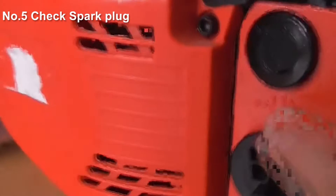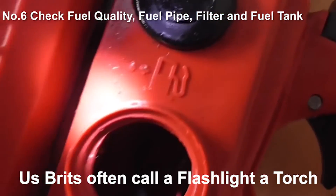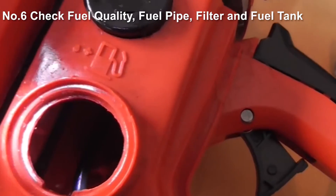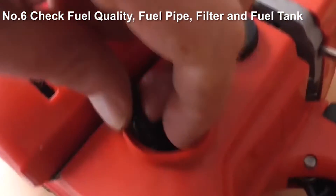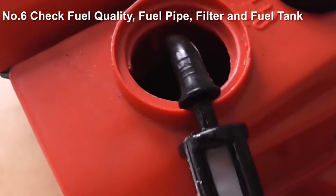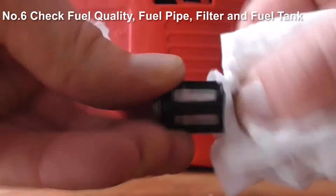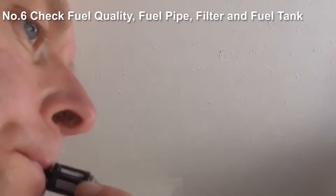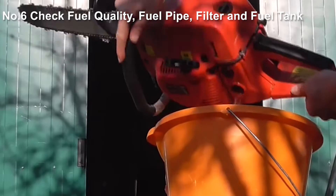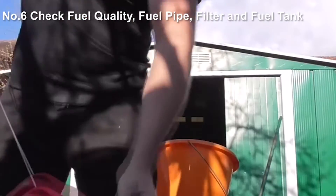The next thing I would do is check the quality of the fuel and take a look inside the fuel tank. The best way to do that is to get a little torch and have a look inside there, making sure that the fuel pipe is reaching into the fuel, that it's all present, and there are no tears in it. Check that it's clean — no foreign material like dirt and crud. Then I would reach in and pull out the fuel filter. We can see it's attached to the fuel line and it all looks okay. I normally take these fuel filters off, check them visually for any dirt, and also check them for blockages. We can generally tell at this stage whether the fuel has got a stale smell. If it is stale, it's best to just tip it away and replace it.